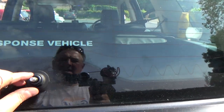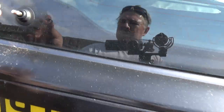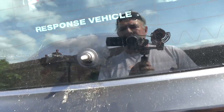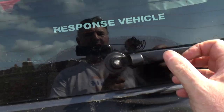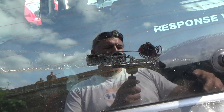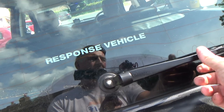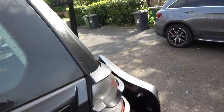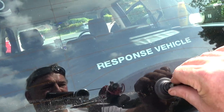And then I need to put that little sleeve. There was a little plastic sleeve thing, which kind of goes in. Let's get the arm. Now I'm hoping that the wiper is in its park position. I was running it and then I turned it off, but it should have parked even if it was mid-wipe. Right, this is fiddly. I just need to get the nut on there. You can see there where it used to come to. So we'll just get it there. Get that nut on and tighten it down. Now, oddly, this nut doesn't have a washer or anything. It's literally straight onto the metal.